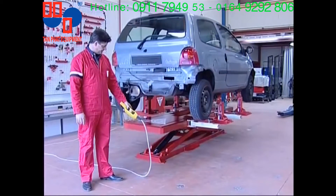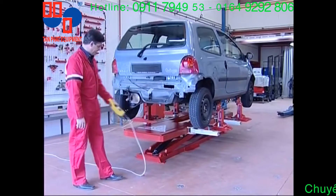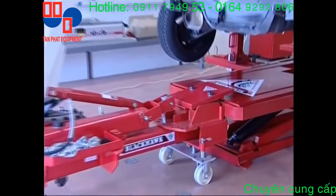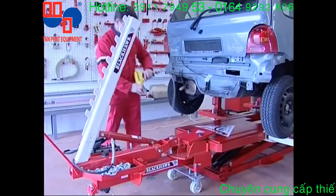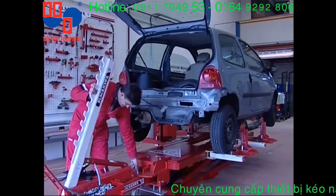When the vehicle is being dropped, the lift stops automatically at a preset height, allowing the operator to install the pulling arm. This multi-directional pulling arm is equipped with a 10-ton capacity hydraulic system fed by a 700-bar hydropneumatic pump.